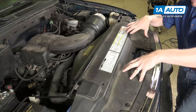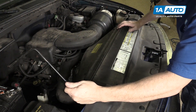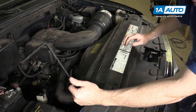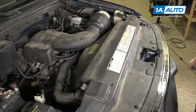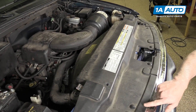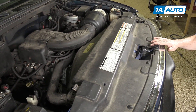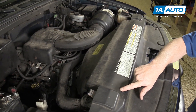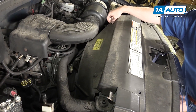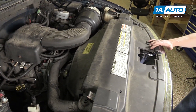We're going to remove this whole panel. We're going to start by taking off the spare tire jack crank. Now there's a series of clips — they have Phillips head screws in them. There are four across the front, two more which are missing on this vehicle, and then there are two clips back here which are a different style, though they should probably be the Phillips screw style.